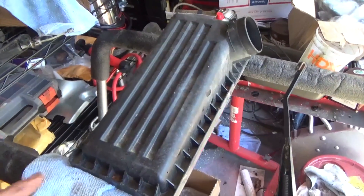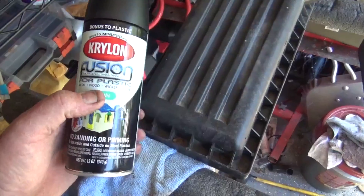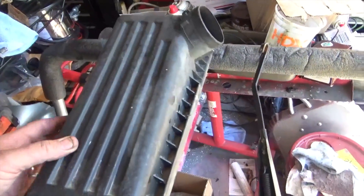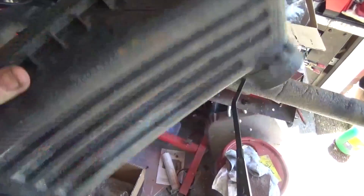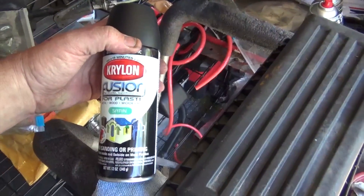One of the things I'm going to be doing coming up — this is Krylon Fusion paint for plastic. It's supposed to bond to plastic, and I've got all these hard plastic pieces here. This is like a before picture. I'm going to scrub it down, lightly sand it with some wet or dry sandpaper, and paint it. We're going to see how that stuff holds up, because it'll make the engine compartment look a lot better. I'm curious to see if it actually does bond to it, so we'll find out.